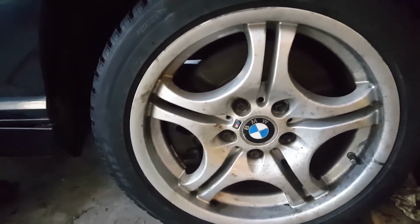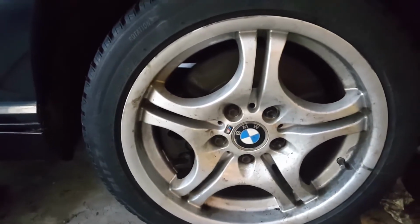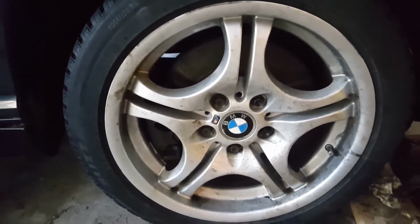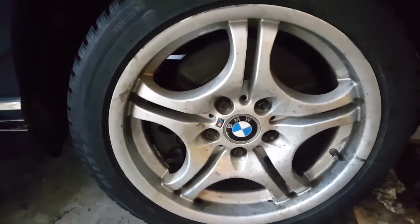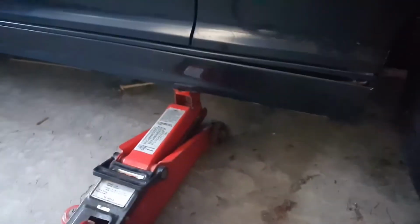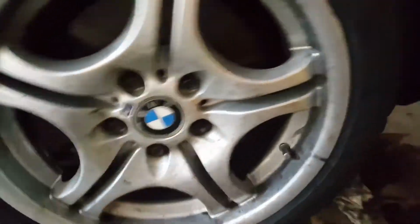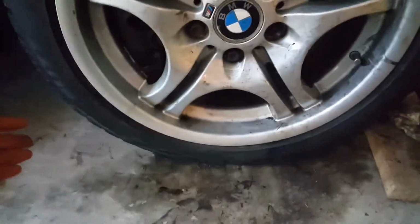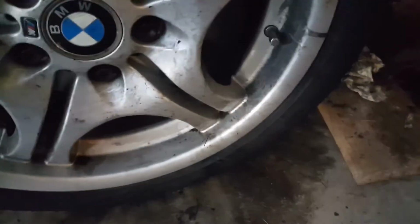as well as any nonsense from a dealer or manufacturer's document telling you to service it every 3 years, 5 years, and so on. The next thing is to find out exactly how bad the situation is. Do you need to do it immediately, or can you further delay? To determine that, you will need to jack up the car. Typically your car has a jacking tool, and assuming that is what you have, jack it up until the wheel is a little bit higher from the ground. Jack the car up a little bit. Use a wood block or something that is tall, it can be a battery or a brick, on the other 2 or 3 wheels, so that the car will not move.